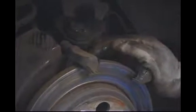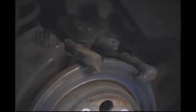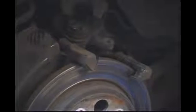You can see the contact marks where it applies the tension from the outer portion of the pad. And that's just how the caliper is designed, and that's why the sound plates or isolators are shaped differently. So you want to make sure you get the right isolator on the right pad because of how they contact; if you've got them mixed up, they're not going to work correctly.